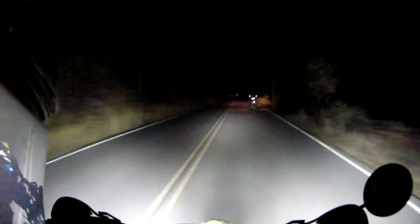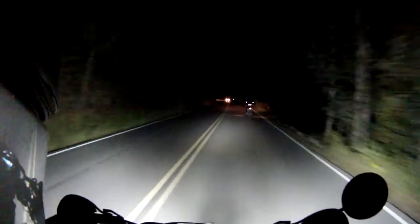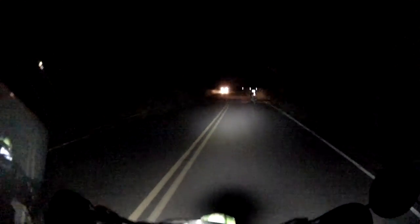Due to the position of the headlight over the fender, it is unable to illuminate the first dozen feet or so in front of the bike, specifically the ground just forward of the front wheel, where tire placement and maneuvering is most critical. Similarly, headlights are designed with the intention for use on public roads. This means that such lighting is rather limited in how wide it is allowed to spread, in order to prevent blinding other drivers, bothering residences, and so on.